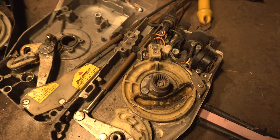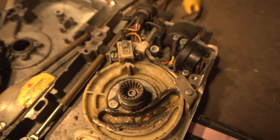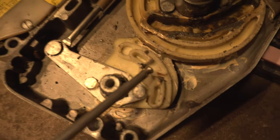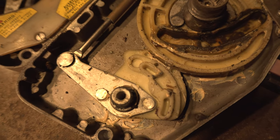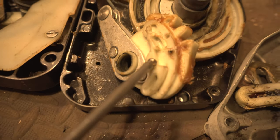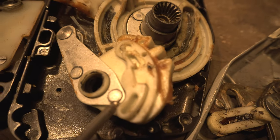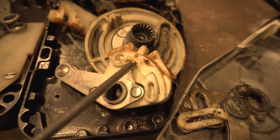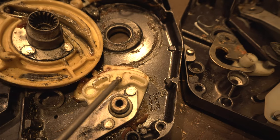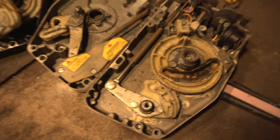One of the most common reasons the choke lever might not work is that this little piece has to fit inside this little groove on the controller — there's a spot for it here perfectly. This groove can get very easily damaged. You can see on this one how the edge of that little plastic is kind of worn off right there. This groove is not holding this piece as perfectly as it does on the other one. So when you try to move the choke lever, it doesn't really do anything because the piece doesn't fit where it needs to.